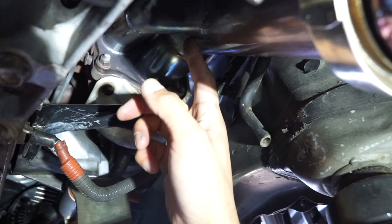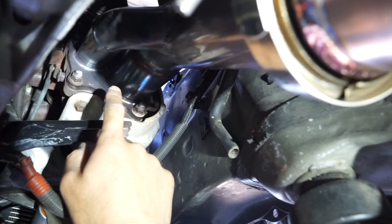Okay, so the downpipe, this guy right here, the turbo elbow, is from Future Fab. And originally I had the atmospheric wastegate dump, but like the website states, it sounded like an exhaust leak. So after about a week of driving it, I cut it off right here and rerouted it into the downpipe.